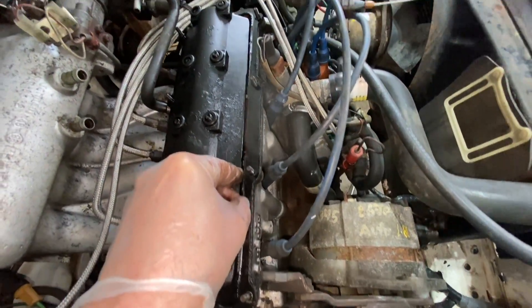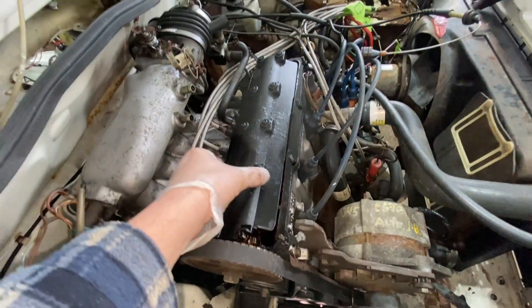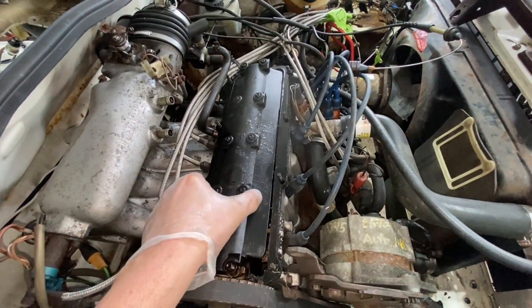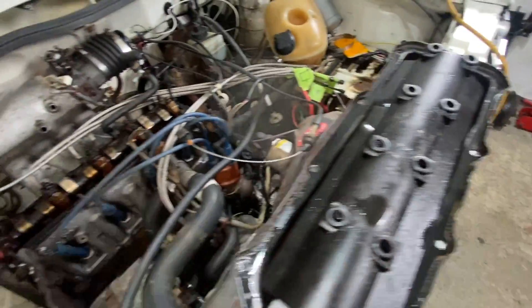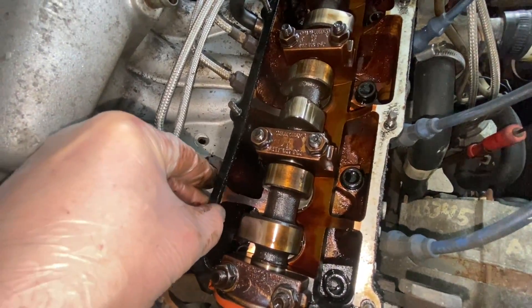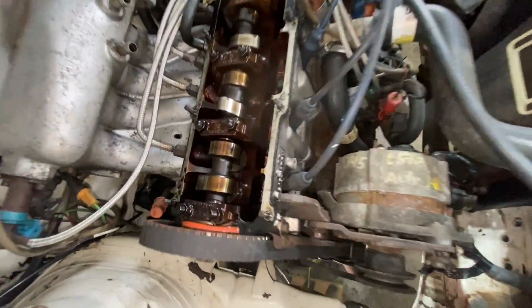That's where it was leaking, as you can tell. This part comes off — see like this — remember how it goes back on. There's a little groove there, and that groove goes towards the back of the motor. This can also be cleaned spotless. Just go around and remove the old gasket — it just comes right off. If it's stuck you'll have to use a razor blade to scrape it off, but I think we're good here.